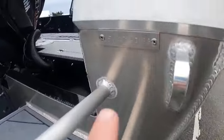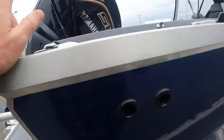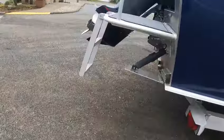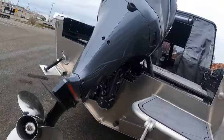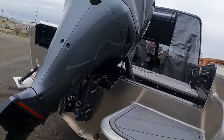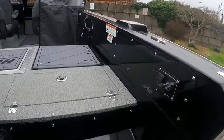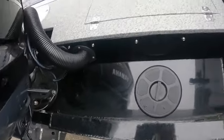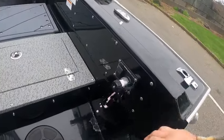2023 — this is right here. You've got your swim step, discharge ports, and anchor light. Here are the snaps, so this must have the full cover. Gear bath oil looks good — that brown is what you want. Stainless steel propshaft, two coats of clear, two coats of primer, special paint. It's got internal and external zinc links — Yamaha is the best saltwater-protective motor you can get.